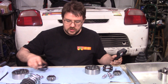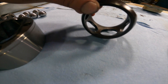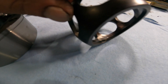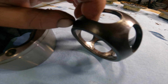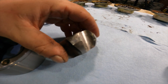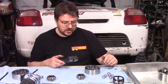The other really interesting thing I noticed is if you look at this one right here, you can see there's essentially nothing of note on the inside there — just a tiny little bit of wear. This one did not have much dirt ingress at all. If we look here, this is the one that had the most dirt ingress. You can see how that's all polished up in there. You can definitely see there's a ton of wear on there. That wear — if you look at the inner race here — you can see there's corresponding wear right there. I don't think this is any cause for concern. It's definitely telling us that these clearances are running very tight.